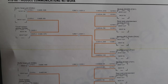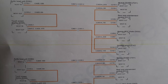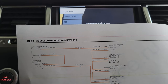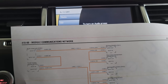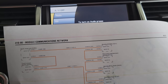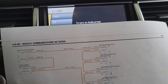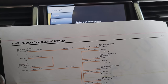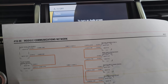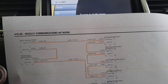That could be something wrong with a module, or a problem in the actual wiring where it's just not getting power. The first thing we need to do is target exactly which module to work on. I have the radio switching to satellite — which I never had before — so something is toggling whether it has satellite or it doesn't. That's problem number one. I also used to have Bluetooth that worked really well, but now it's non-existent. Both the Bluetooth module and the satellite module are in the back corners behind the panels in the trunk, so we're going to go back there and diagnose what's going on.